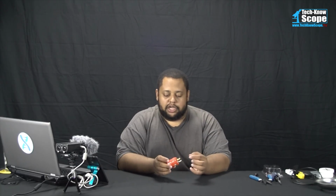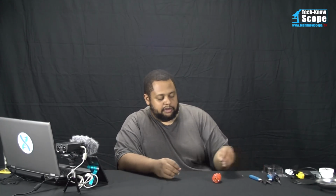Now, what I'm going to do as an alternative, say you don't have the power supply in the case, but you still want to ground the case some kind of way. I'm going to use one of these guys right here. Now, ideally, you would pull these two prongs out, the ones that are normally for your power. Now, this is U.S. power. The top two prongs are the power, and the third prong here in the middle, at the bottom, the very long one that goes in first, is the ground. So basically, what we're going to do is hook a wire to that ground, and the other end will connect to this alligator clip. Anytime we need a ground for a chassis, we plug this in, hook this clip to the case, and it grounds the case. That way we don't have an ESD problem.